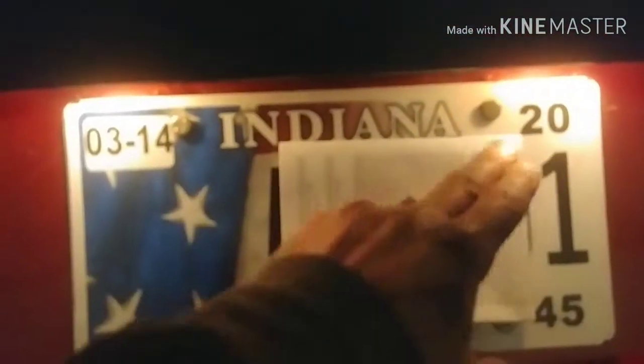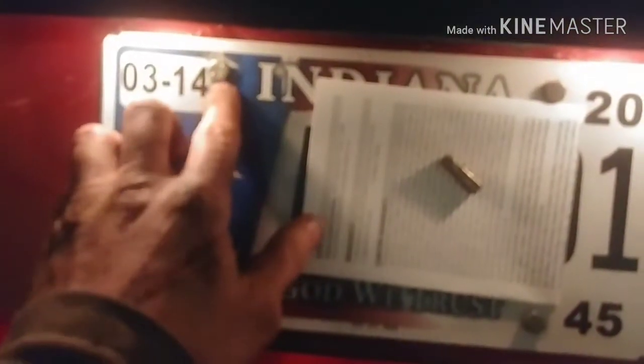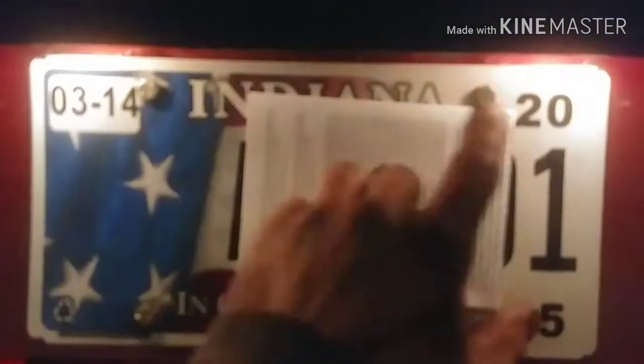All right. The license plate was in the back window. Both these license plate retaining screws were seized. I ended up freeing this one up, but drilling out the threads, drilling this one out, and it didn't have lower ones. So I installed the top two. I welded 7/16 inch nuts to both original locations. I scribed the marks on the bottom, drilled both holes out, and then tack welded the 7/16 inch nuts to the bottom of the plate.